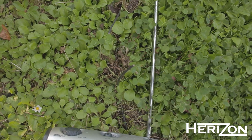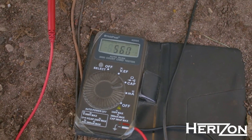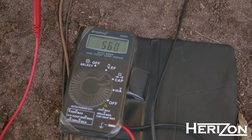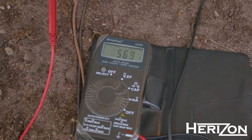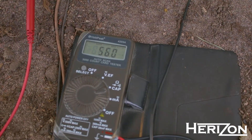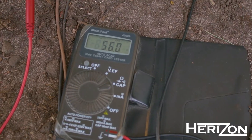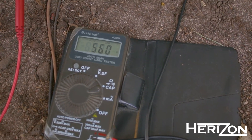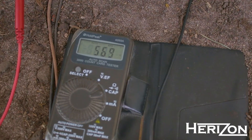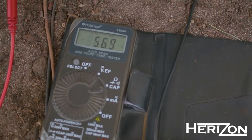The accuracy is about one meter. Some people might say this is very easy to find because the resistance is so high. But let's say the resistance in the boundary wire is 56 ohms — the robotic lawnmower is not operating because the resistance is too high, but some current and signal is still passing through the boundary wire, making it pretty difficult to find with this radio method.